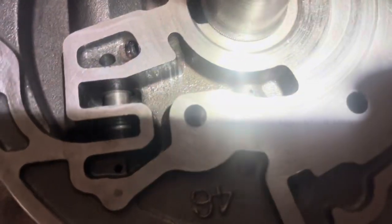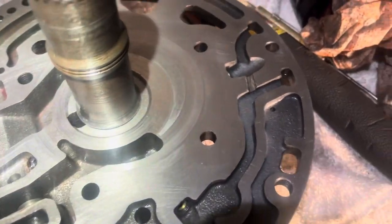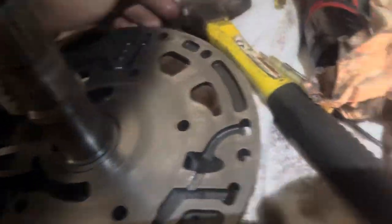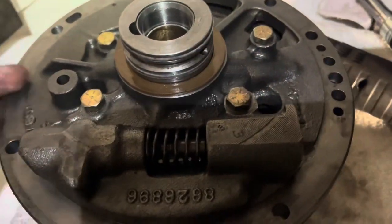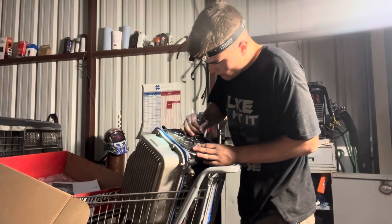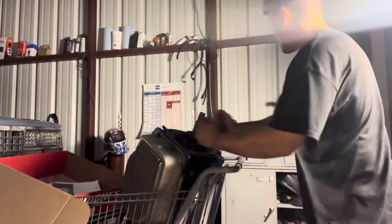Got that one drilled. There's not really a depth you gotta go to — you go and you'll feel it kinda sink itself into the channel. You know it's good. Put that up in there. Loctite of course, or a little thread locker. Putting the pump back together — I picked up this tip from my builder: center everything up to make it go in as easy as possible into the transmission. These are like 190 inch-pounds — that translates to like 15-16 foot-pounds, which is what I found on Yellow Bullet. That's back together, about to drop this thing back in. Did you hear it? I heard it.